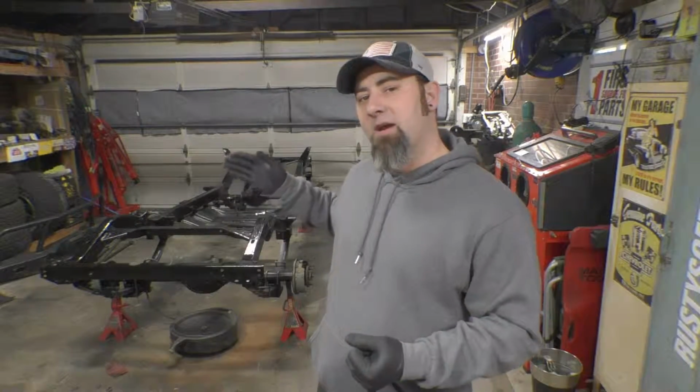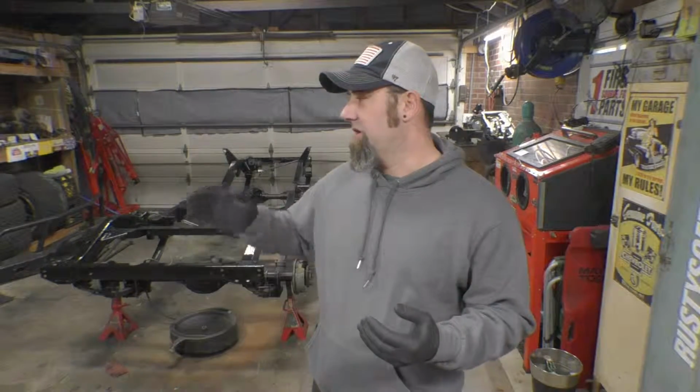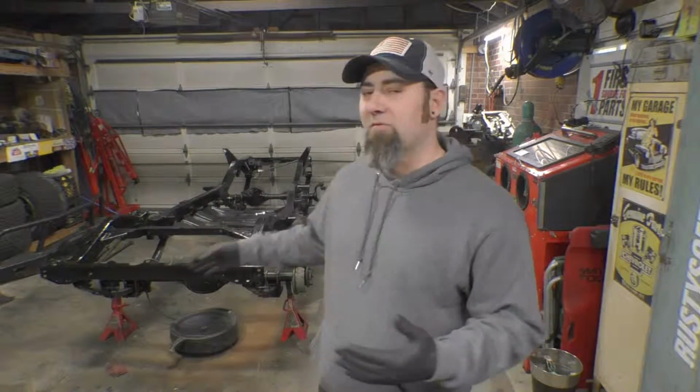and on the road, I want to make sure the gears that are in it are going to be right for the powertrain, and provided everything feels good and it's not hunting for gears or anything like that, then we'll go through and do an overhaul of the entire thing. I'm suspecting that I'm going to need to change the gears. I've done a couple gear calculators, and though we're using a diesel engine that's got more of a power band like a car, I still think there might be a little bit of problem in the future. So I'm holding off on the bearing overhaul, but we're going to get to the rest of it right now.